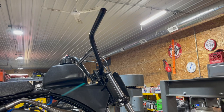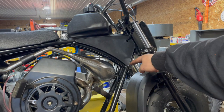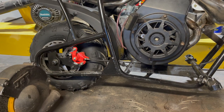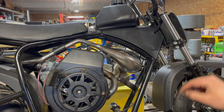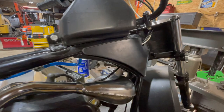I just got done doing some internal cable routing. What I did is I ran these two cables through the hole behind this little plastic plate, and then the brake cable runs down and underneath — it's going actually through the engine bracket; I drilled a hole through there so it's using that as a cable guide, and then back to the rear brake. That just looks a lot cleaner than having the cables tied to the outside of the frame. We're going to have to get this kill switch wired up to this engine, and then after that we're going to run the throttle cable down through the frame as well so we can get that all tucked away for a hidden, clean look. Got the throttle cable ran through the frame up to the throttle and it's working pretty good, so that finishes the carburetor setup.